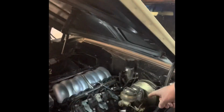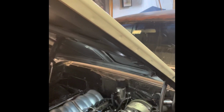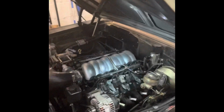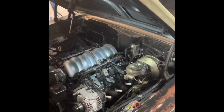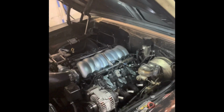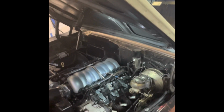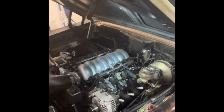So my suspicion is this guy. This is your generic GM Corvette style, old school, dual master. It's all over the place. My question is, how big is the bore, and what's my throw length coming out of the booster? I don't know. I put this thing in 3 years ago. I threw it in. It's possible I don't have enough master anymore for the new brakes.